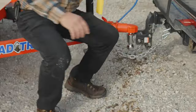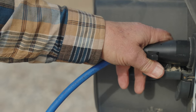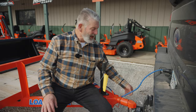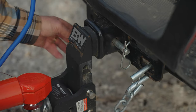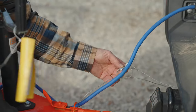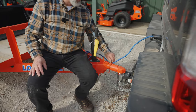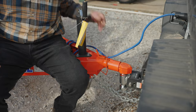Next, make sure your electric is plugged in properly. This trailer has brakes, so we have something called a breakaway cable. That cable should be hooked to the bumper or the hitch on the truck — not the chain, but right to the hitch. We put a little turnbuckle on there so it's easy for the customer to hook it up. I like to run this through the clip on the coupler because it keeps the electric wires and the cable off the ground.